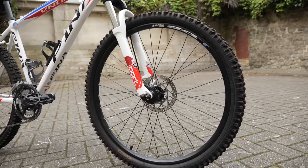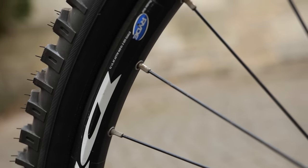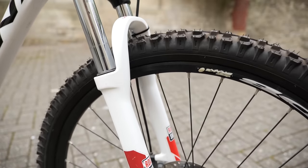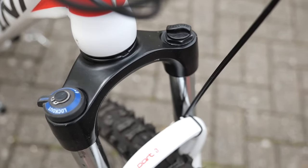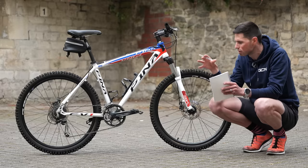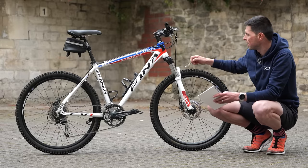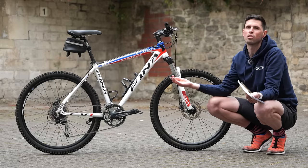Let's start with wheels. The bike's currently fitted with 26-inch wheels, which aren't going to be much use trying to convert this to a gravel bike. I would have gone with a 700C wheel, however I don't think we've got the clearance on the crown of the fork nor on the rear of the frame. So I'm going to go with a 650B wheel — slightly smaller — then I can pick a tire relative to the clearance I've got on the frame. Next up, groupset: Shimano GRX. Easy.